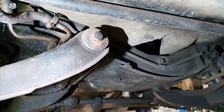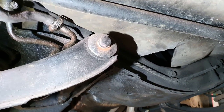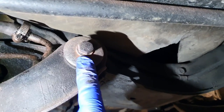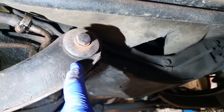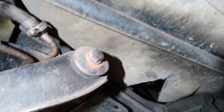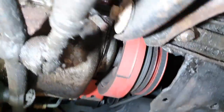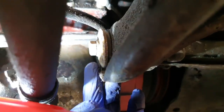One thing before compressing the bottom arm: the spring obviously moves, so what I would do is undo the rubber bush bolts slightly. As you can see that one was already loose there. On the modern cars I will undo it to release a bit of pressure on the rubber - both sides, one in there and the other one there. Loosen up just a little bit, and obviously don't forget to do them up when we're done with the job.